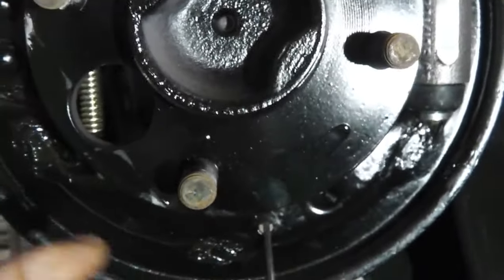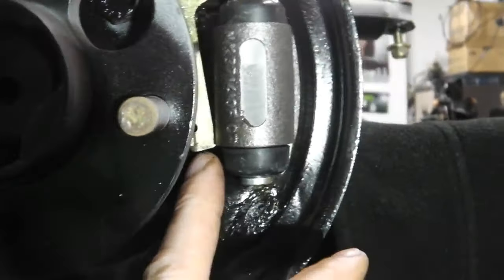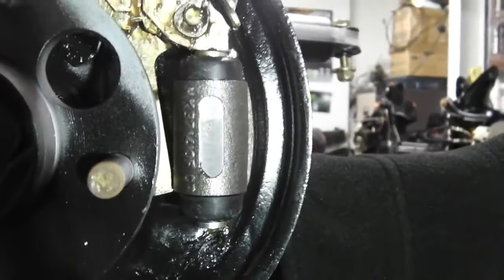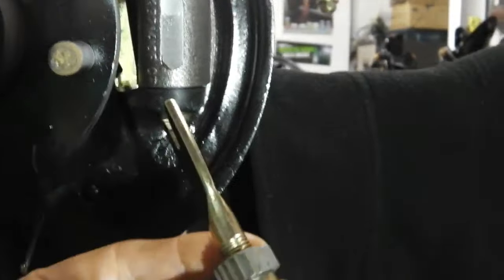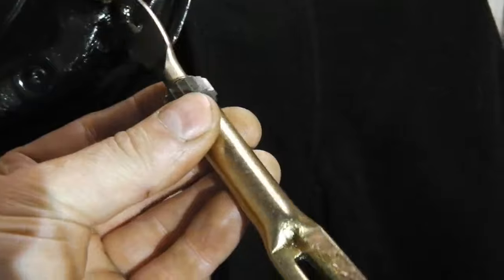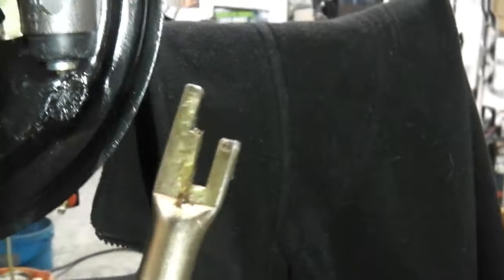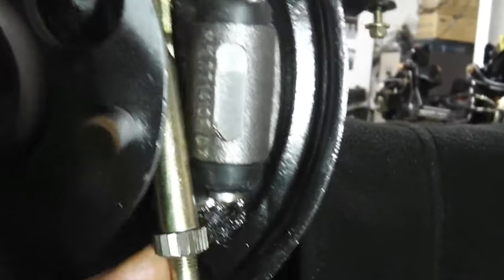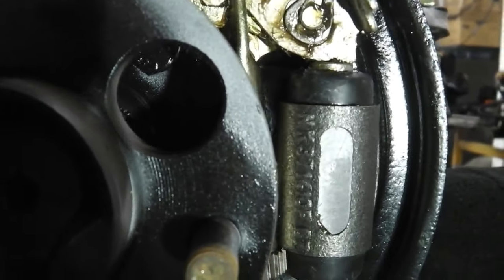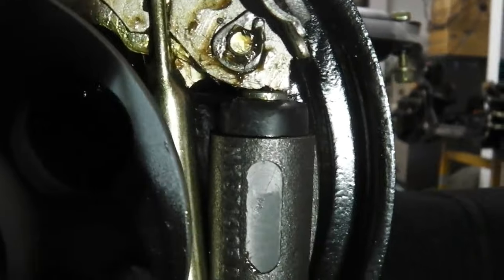What we do now is we're going to get this ready. We're also going to get the fork, the adjuster fork, ready. Let's take the adjuster fork first. I reach back and grab it off screen and bring it into view. That is the automatic handbrake adjusting fork. Funny shape at that end, fork at that end. And the funny shape at that end goes up with the longer piece on top and engages into the area where the handbrake lever is. And that slots up inside there.